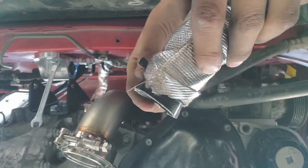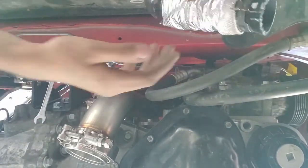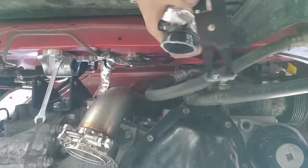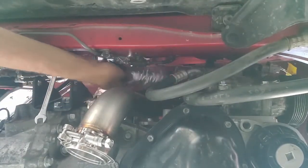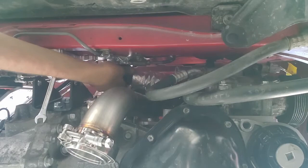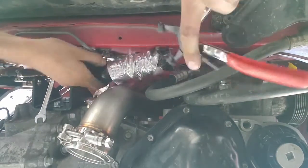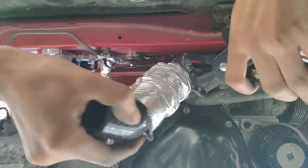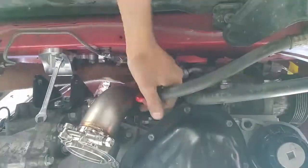Now this part is difficult. It took me a few tries to get this right, but before you install the silicone coolant hose, you have to accurately cut off the right lengths from the hose. If you are about a centimeter off from the mount, you will find it almost impossible to install it. On the chassis side, you want to leave about 2 inches of tube from the center of the hose. On the engine side, an inch needs to be removed to allow fitment.